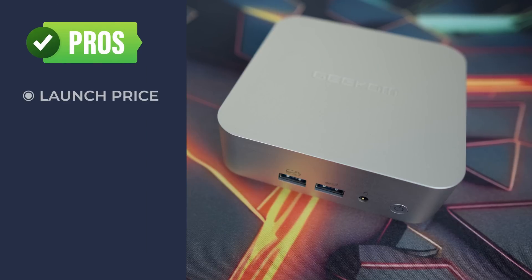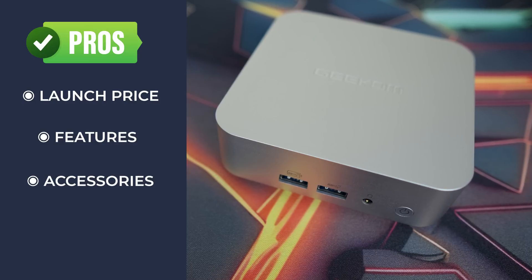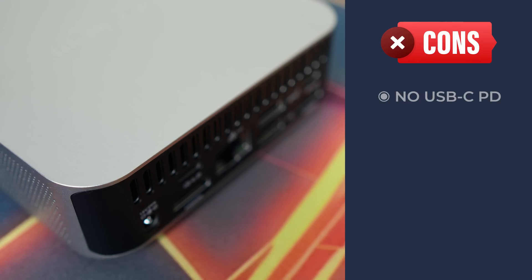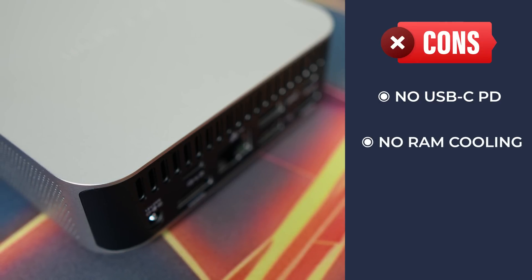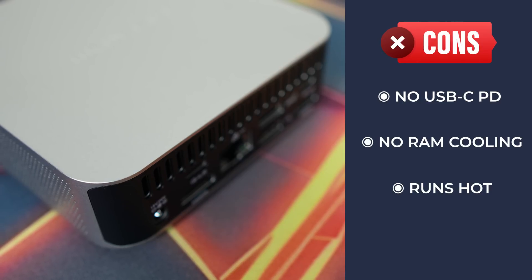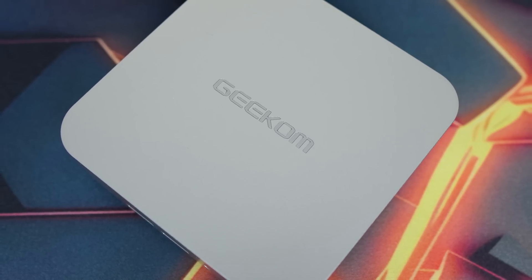So we've looked at a lot of what's on offer with Geekom's A6 — now it's time for the conclusion. The price for what you get is pretty good and includes a pristine aluminium alloy case, 3-year warranty, compact power supply, and a 1TB SSD with 32GB RAM. It's tiny but still has space for an additional storage drive. That said, I would have liked to see USB-C power delivery support. The DDR5 memory is not actively cooled like on other minis, but unlike other minis, GPU performance didn't drop. Being as small as it is, there's a lot of heat to deal with, so temps on average are higher than larger minis, but the maximum still stayed under 100°C. Fan noise under load is higher than average. The last couple of Geekom Mini PCs have improved a lot over previous options, and the A6 is a pretty good choice for the value shopper that still wants some of the higher-end features. But if you want to go bigger, better, and pricier, then the Geekom A8 Max might be of interest.